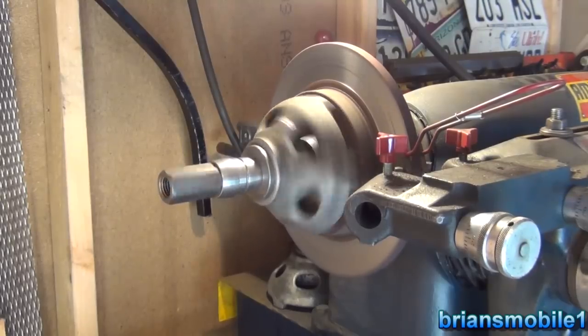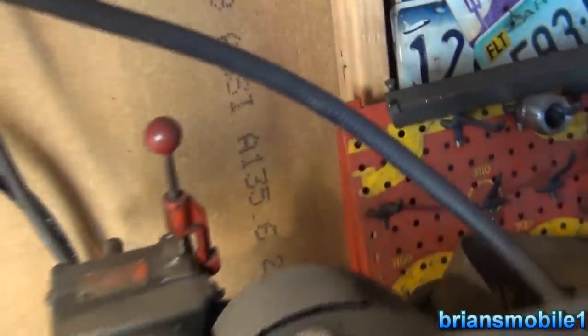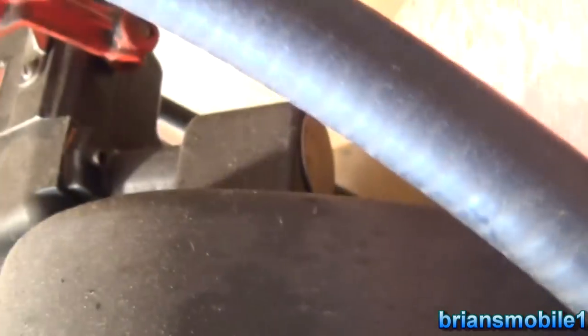You know what's cool about these brake lathes? Let me tell you. They have a mechanical fuse with a plastic gear. You get all the drive on this side, and it turns all this stuff, and it goes back here to this, and then inside of here, there's a little cap. And you take this cap off, and inside of there, you have a plastic gear. Here's some extra parts for the lathe. See that?